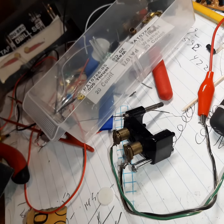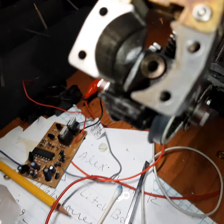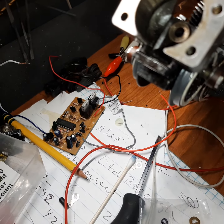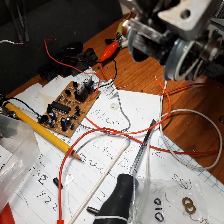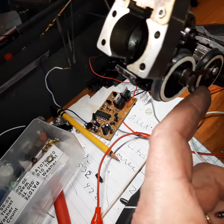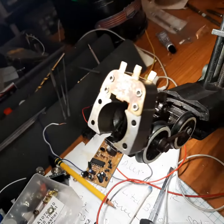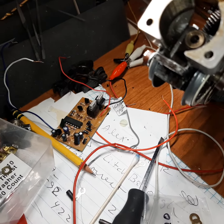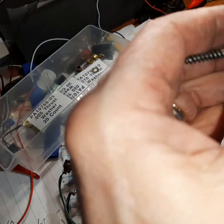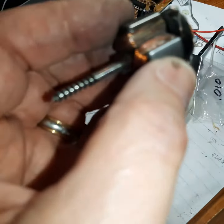I've ohmed it, it runs fine. I'm going to do a little more cleanup, then I will reassemble this and do a test run. I need to find a way of determining pull — I don't know if I can just line up a bunch of cars and see what it can do. It's got rubber wheels. This is just an old one I pulled right out of the box. This armature is an old armature, but the field widths of the plates are the same, so it should be compatible.